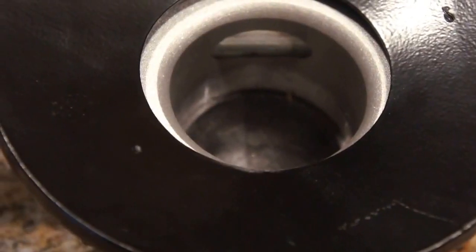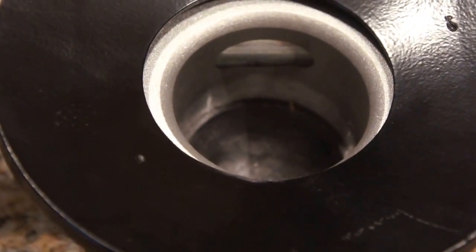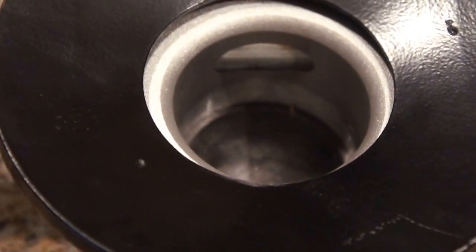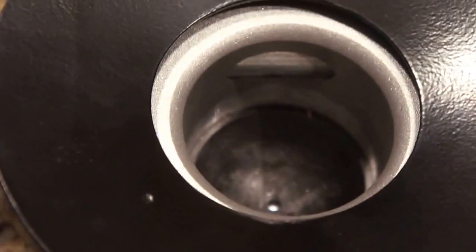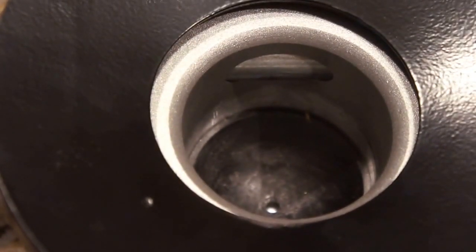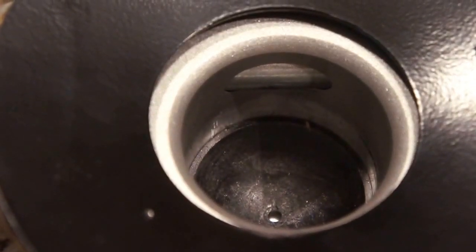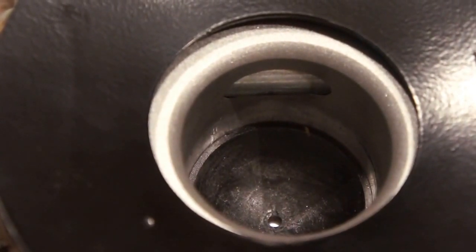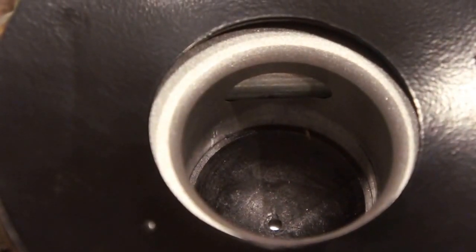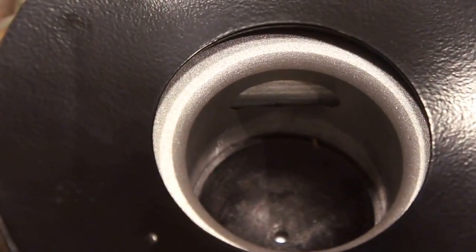Some folks would like to know, what does it look like inside the ball cavity? So this is the Kingpin adapter turned upside down. I'm looking through the funnel, so basically this is the part that would drop onto the ball that's at the top of the pyramid that makes up the Andersen Ultimate. So you can see it's kind of a dome shaped in the bottom. That's where the top of the ball rests. You don't grease that, it's just dark in color. I assume that's some kind of coating, but anyway, it's greaseless.